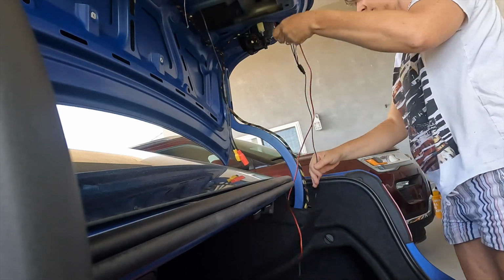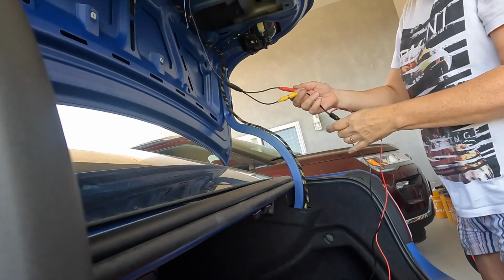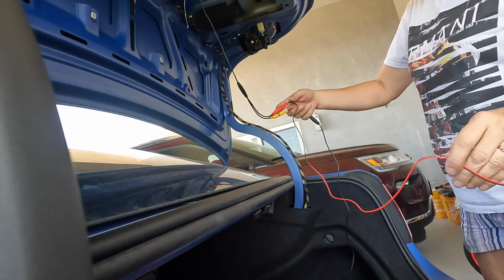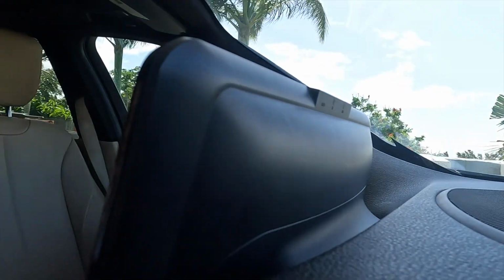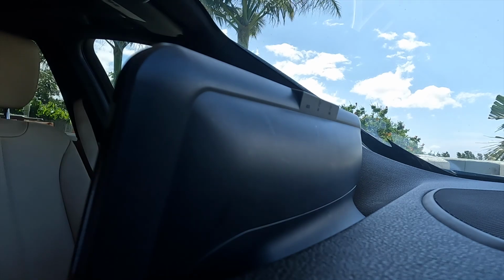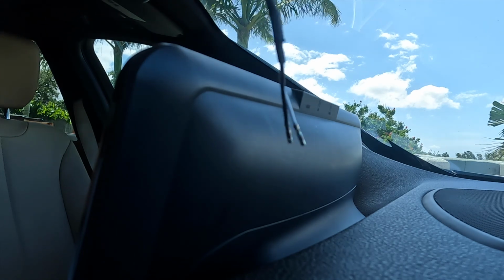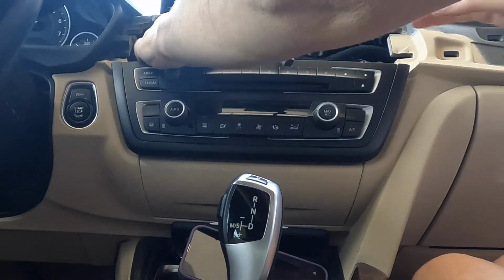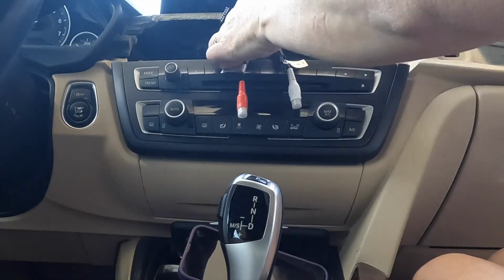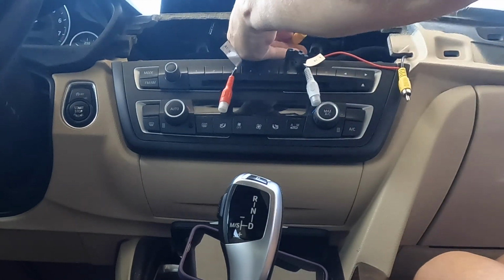So I'm going to need to put it up there and then connect it up there. I need to connect the two RCA jacks together. Sure. What's this for? No idea. Who uses it? To get the big connector in, I'm pushing it down and left. So after pulling out the microphone wire, literally from the connector, which is the little white connector, pulling the ends of the microphone wire out, I can finally bolt this thing back in. Well, yeah, there's no room up here anymore. I mean, it's just a mess and tight. So now we connect the camera here, we connect the other part of the camera to where it says rear camera here.